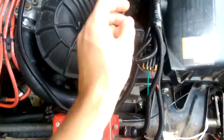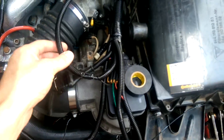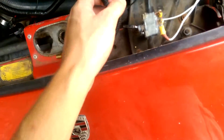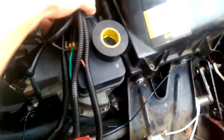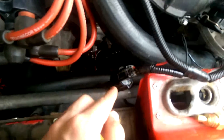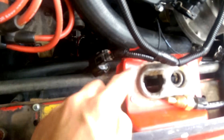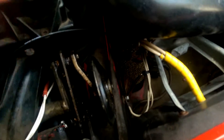This is the final form of the main harness for the sensors. Everything has conduit on it, even the little MAP sensor. You've got the intake air temperature and the same sensors that have been here. The ground clip is on the bottom — you need to quick-disconnect any harness runs. This is for the Hall Effect sensor, and it's kind of awkwardly placed — stuck behind the upper radiator hose so the wiring doesn't hit the timing belt, since I'm starting it without a belt cover. That won't be like that for real once the car is on the road.